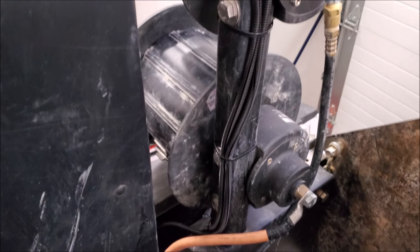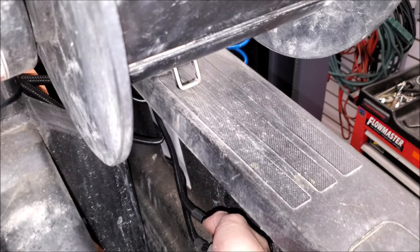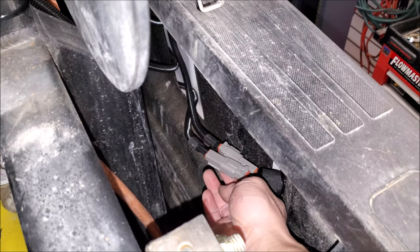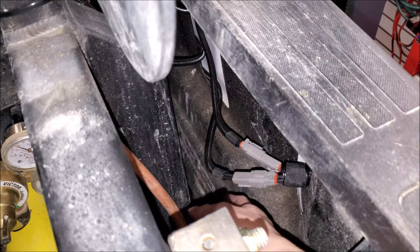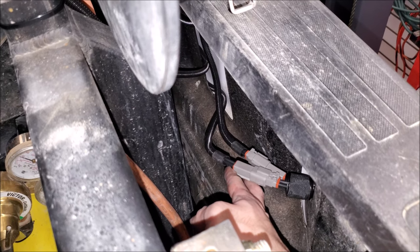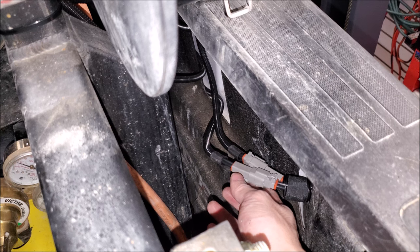That way the reels can still work but everything's really serviceable. The client asked that the sled be removable — you can see it's inside the vehicle and secured to it, but the whole assembly can come out as one. However, if we don't put on connectors, our lights will get ripped out. So I've put Deutsch connectors on — two-pin ones. I like these because they are very good at protecting from the elements and they're also easy to plug in and unplug.